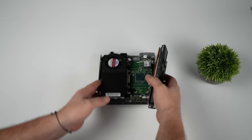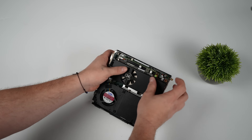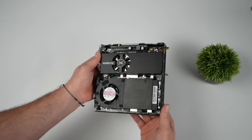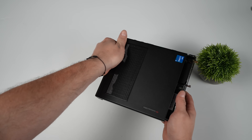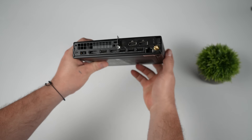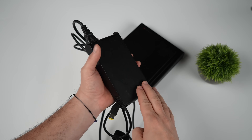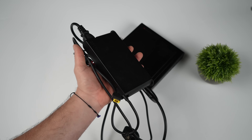I do want to mention that I had issues with the RX 6400 at first with this PC. I had to update the BIOS and firmware through Windows in order to get it to be detected properly, so definitely keep that in mind. One last thing I needed to add to this system is a higher wattage power supply. These usually come with either 65 watts up to 90, but what I've got here is a 230 watt with that Lenovo proprietary connector — just a gaming laptop charger I got on eBay.